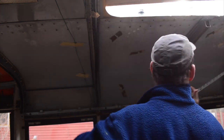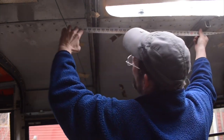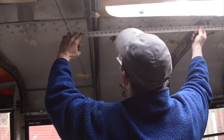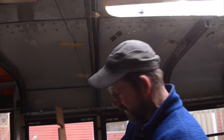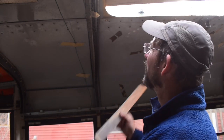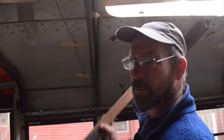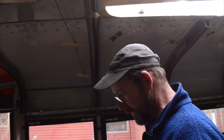That way it's pretty accurate right out in the bend of the tape. The bottom one I can run the tape right by and see it's 56 and an 8th — so it's a little bit longer there. I'm going to cut my steel just a little bit long, about a 32nd, and gradually grind it down for a nice tight fit. To test my angle, I cut some angles on a piece of wood and put it in there to test first, because scrap wood is cheaper than metal.